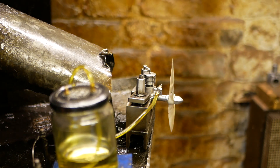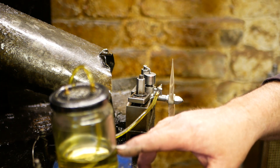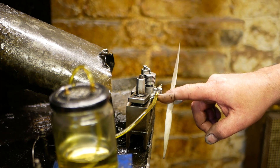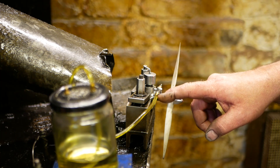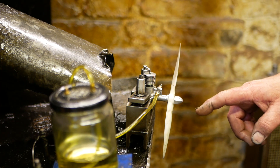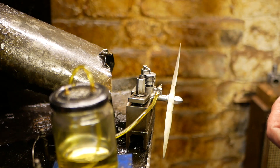How to start a PAW 55 from cold. The most important thing is to make sure the level of the fuel in the tank is level with the needle valve. If it's too high the fuel will siphon in; if it's too low the engine will find it harder to draw the fuel to the engine. It's better to have it a little bit low than a little bit too high.